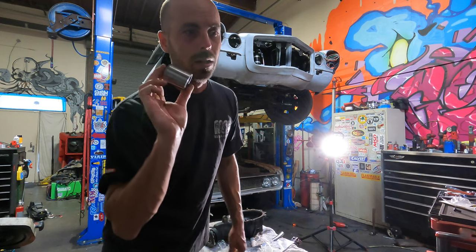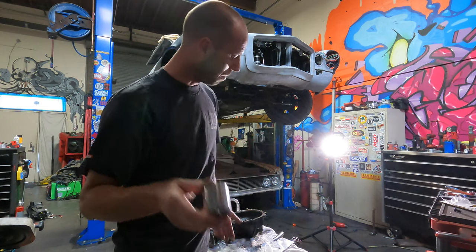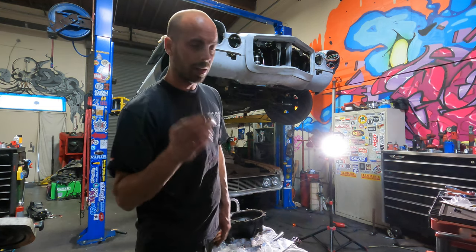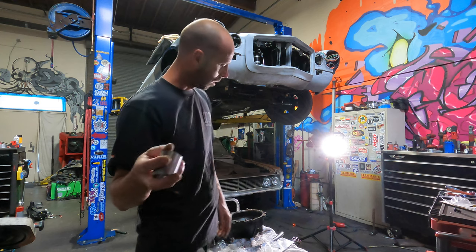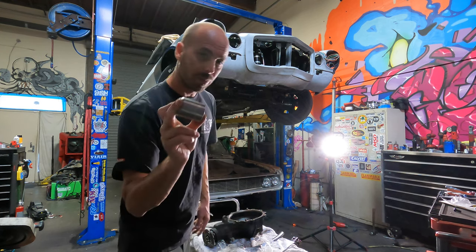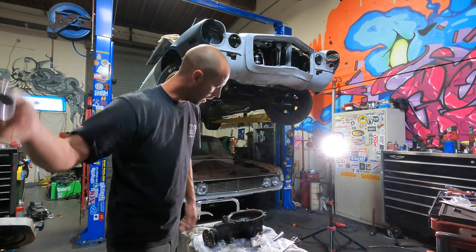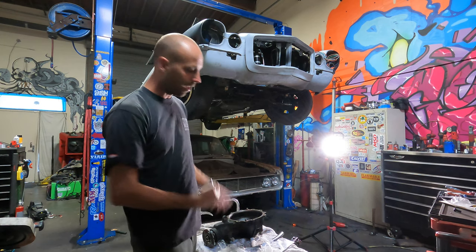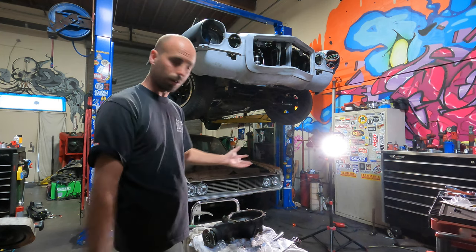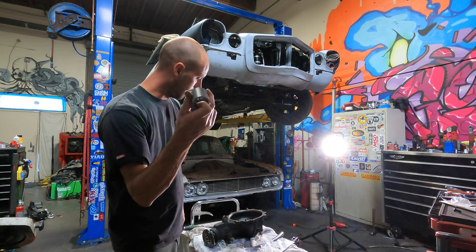It's solid. So if you hit your pinion flange on a rock or you're hammering on it, it's not going to start to crush over time, which is a big problem for these things. So the solid spacer goes in its place, very easy to set up. And that's what we're going to work on today. And hopefully we'll get this thing buttoned all back together and back in the truck, because this is the last thing I was waiting for.